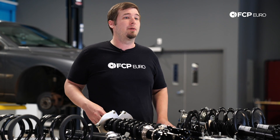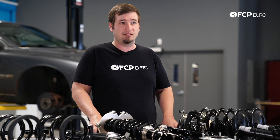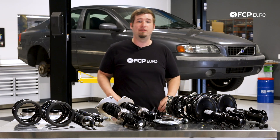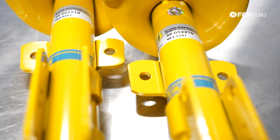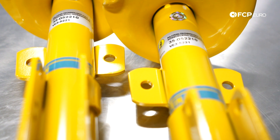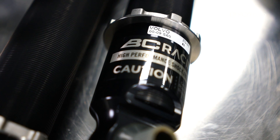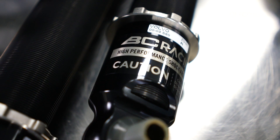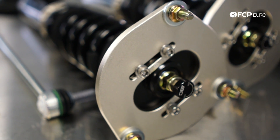At the time of filming, we don't have a specific solution for this, but we do try our best to stock as many 4C specific shocks and struts as possible. For sports suspension fans, we are happy to offer Bilstein B6 HDs for P2 models, which feature a slightly stiffer and authoritative handling damper made for stock ride height cars. We also have Bilstein B8 Sports, which feature the same valving but are designed for lowering springs — they are different due to the positioning of the internal bump stop. BC coilovers have also been very popular and get consistently great reviews, and pairing the FCP Euro lifetime replacement guarantee with a fairly low price point, that's no wonder why.